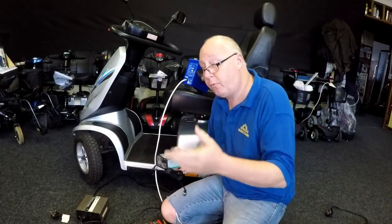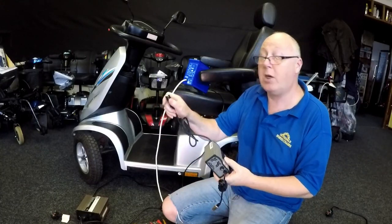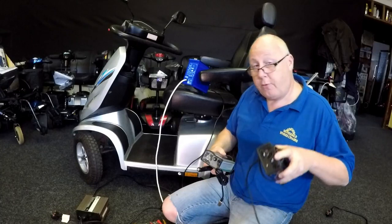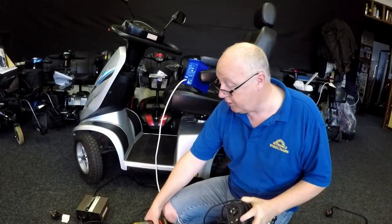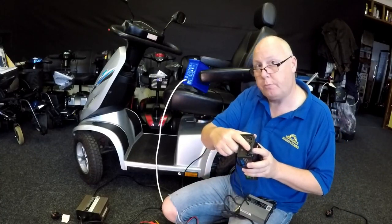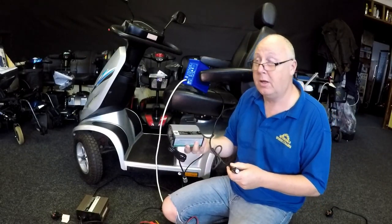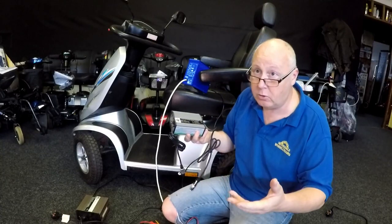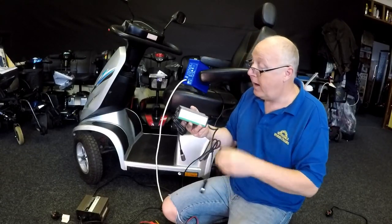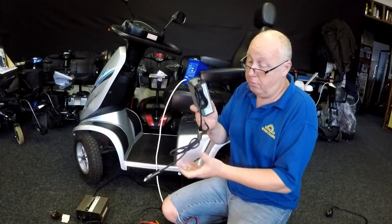We also do in-car battery chargers for small foldable boot scooters — still with the three-pin connector, DC to DC. Put that on your cigarette lighter and it will charge your battery — it's also got a fuse. Check that with your continuity on your multimeter. They may have the power light coming on but the fuse could be blown and it won't charge. I don't really like them, but if you're doing a lot of travelling and can't take the scooter into the hotel, you can plug that into your scooter and plug that into the cigarette lighter — some cars have a connection at the back. This is a 1.5-amp, so it'll take a long time, but you can use it in a car, no problem.